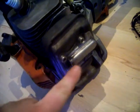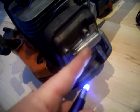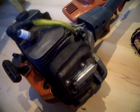So what I done, I unbolted this, took that off. As you can see, I cleaned it and scraped all that dry soot out — I had to get a flat-edged screwdriver just to scratch it off. Cleaned it all up, put it back on, started it, and it runs fine now.